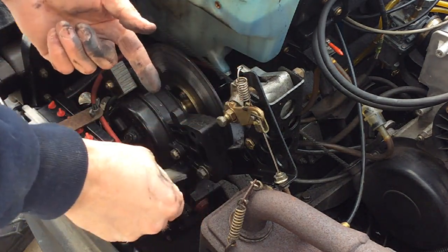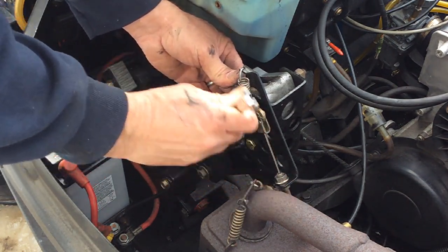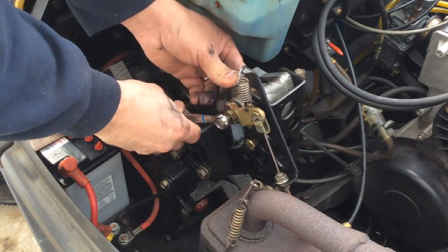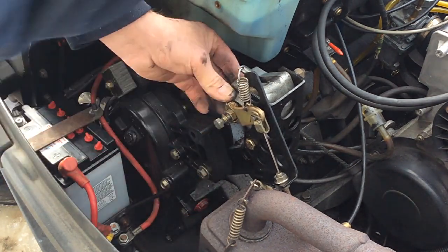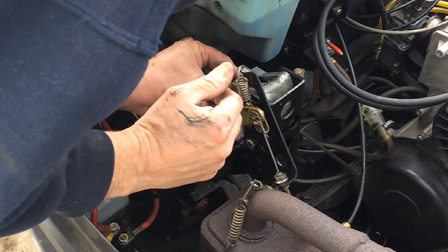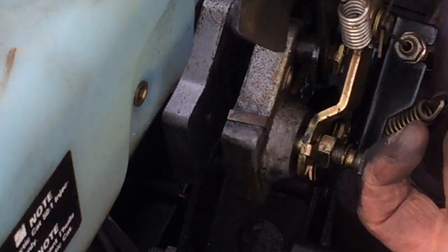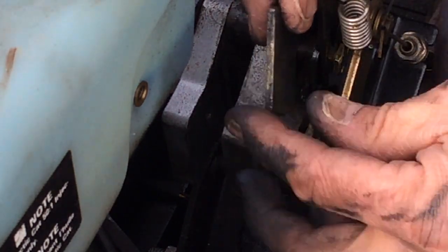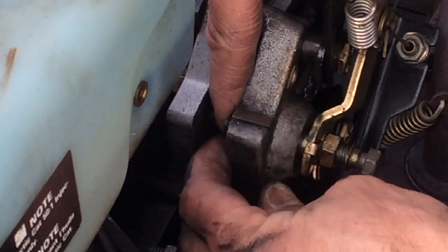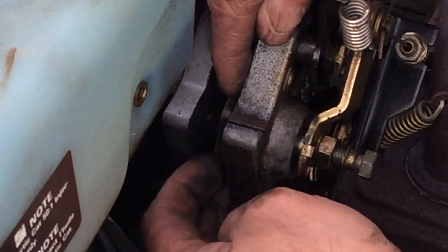There's the other pad, and I've got two brand new pads. So let's go ahead and loosen this adjustment up here — it's pretty much already there anyway, so I'm going to back that off quite a ways so I can get everything in there. That metal piece right there goes right inside there. This metal piece has to go on this side where the bolt pushes against, because if you try to push the bolt against the pad you're just going to crack it. So you're just going to slide it in there and then put that pad right on top of it.